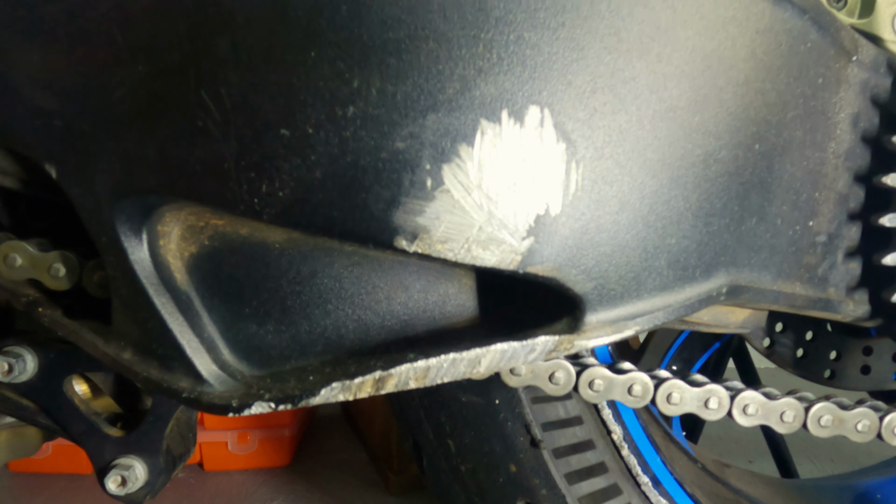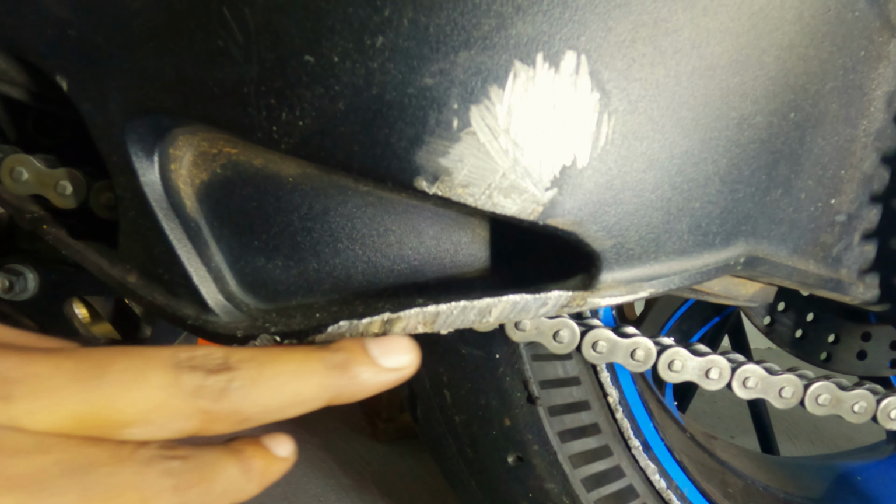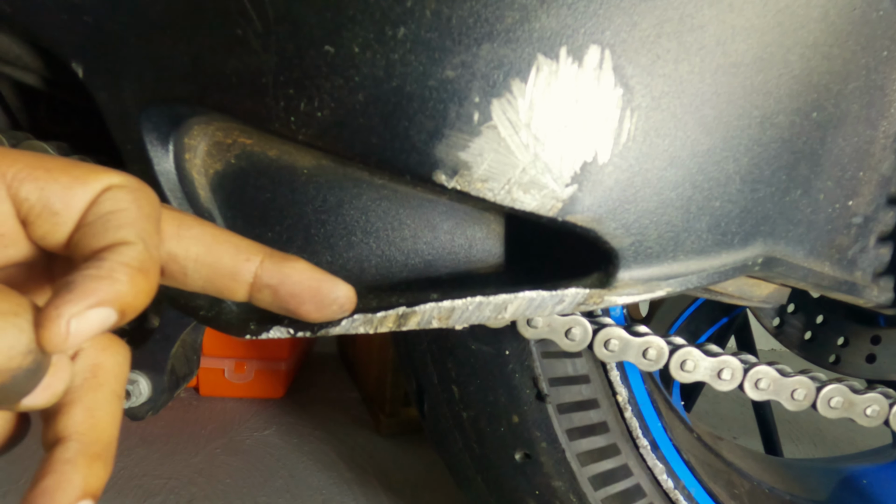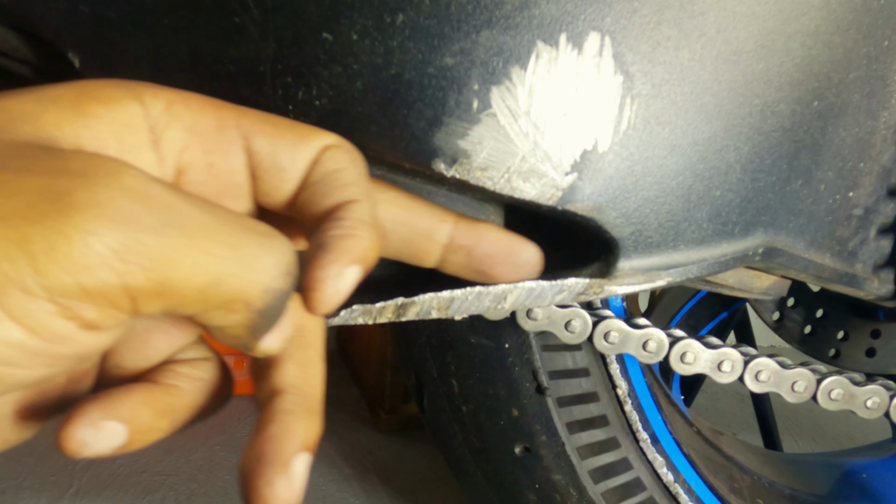Now obviously the swing arm has a bit of a texture to it, a bit of a finish here that has some texture on it. I don't know how we're gonna reproduce that, but we'll try and figure that out during paint. So we're gonna give this guy here a bit of a wire wheel just to make him flat and smooth, and then down here we're gonna do the same right over here, and then along these sort of raised edges I'm gonna try and get a file, and then we're gonna file this down a little bit.